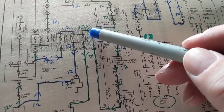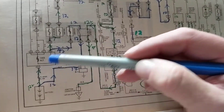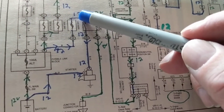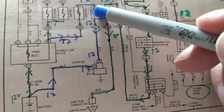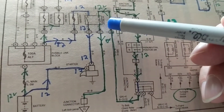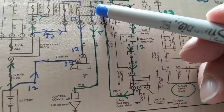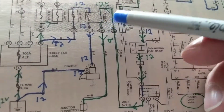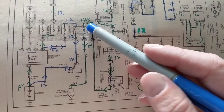The problem is no-crank. Let's start over here — 12 volts. I can test this point at 12 volts; the other point goes to zero. Starting from the battery: 12 volts here, 12 volts over here. We came off a fusible link at 12 volts — we didn't lose any voltage. Going this path through the fusible link, no voltage loss. When the switch is closed, 12 volts — no loss going through the switch to the solenoid. Over here we have zero volts and 12 volts. The voltage drop from here to here is 12 volts — that means this component is working. If both sides are 12 volts, you're floating, not connected to ground. Let's say we're at zero volts — we measure zero at the relay.